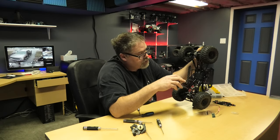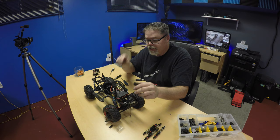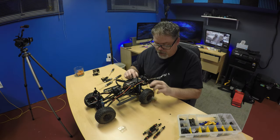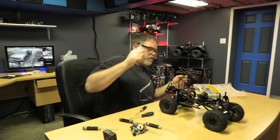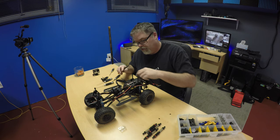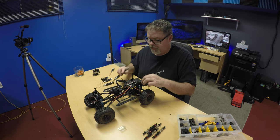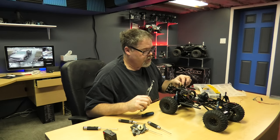I wouldn't want to go much higher with this or she won't have much travel in her. But we're gonna have to. We should maybe cover up this wiring though because it's pretty dickered. So the winch doesn't work so we don't need that wire. This here is going to nowhere so we'll just leave it. This here is ground, this is positive so cut that off so it doesn't short out on anything. And then this can just sit up here for now.